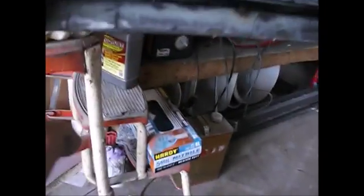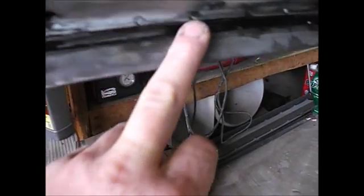Of course, now after I get it primed, we'll seam seal all this stuff up really good, all where my little welds were, right through there. But it's just protected. It's all ready to go. Everywhere there was surface rust, I applied some Por-15, and then after it set up a little bit, I took a lacquer thinner rag and just wiped it all down. Makes it easier to prep it up for some primer. Had a little surface rust going on right up in here, so I took care of that.